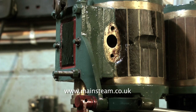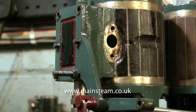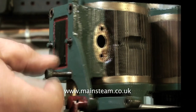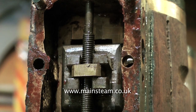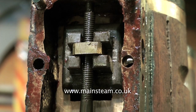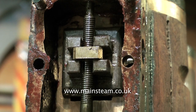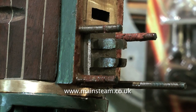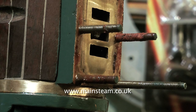The expansion link, as I've shown earlier, is just held with a couple of rivets pushed in. The rest of the fittings are simply bolts and they really need to be pins for a good bearing surface. Here's the close-up of the slide valve — although it looks a little bit rough it seems to be okay. I can't say I'm too impressed with the way the metal's been hacked away from the inside surfaces of the steam chest. The face of the slide valve is fine, and if you look at the ports on the actual cylinder, the ports seem to be relatively unmarked, so that is a good thing.